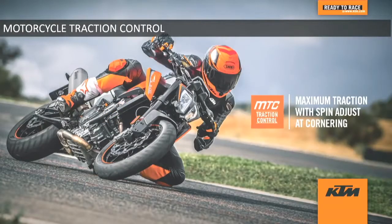The 790 Duke comes with the motorcycle traction control, which reacts whenever there is excessive slippage by smoothly decreasing the engine torque, thus reducing the slip in proportion to the lean angle. The anti-wheelie support function ensures that the front wheel is always on the ground. The MTC system works in the background and reacts within milliseconds, so it's hardly noticeable as an intervention. Let's take a quick look at the video.